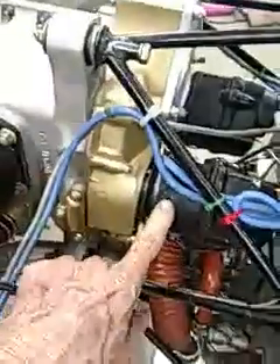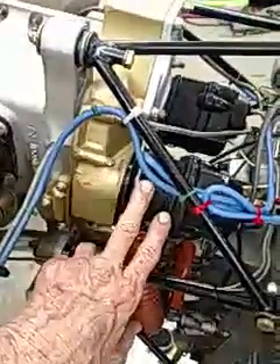It's pretty dry overall. It looks like this mag gasket might be leaking a little bit. This is the left mag — it was the one giving me issues in the beginning, and I've had it on and off about three or four times now. It could be that it's just not sealing well anymore. But it's all pretty dry and still looks pretty good. All the welds look good on the engine mount — I don't see anything busted.